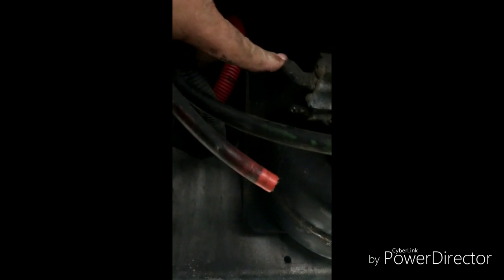And I got the air compressor governor, and this is your air compressor governor right here, mounted to the side of the air dryer. Anyway, I got the line unhooked from it, and the primary and secondary lines here. Now I got these 3 lines on this side that I replaced the fittings with compression fittings.